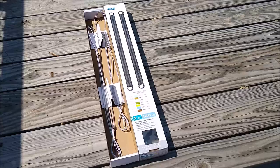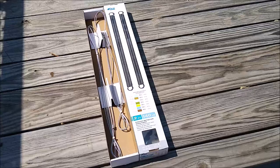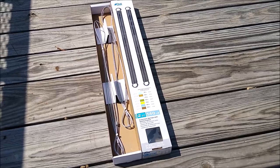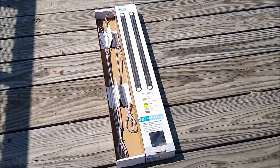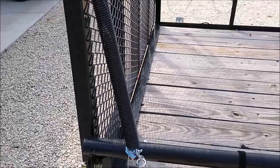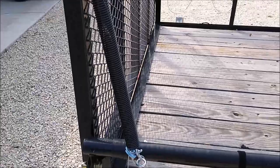When you buy replacement garage door springs, they usually come in a kit like this — you get two springs and two safety wires. Safety wires are standard equipment on garage door springs used on garage doors. What they do is restrain the spring from bouncing around and throwing off pieces when they break. You're going to thread a safety cable through the center of the garage door spring to restrain it in case it breaks so it doesn't go flying.